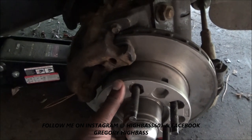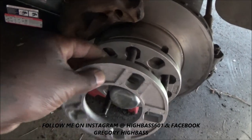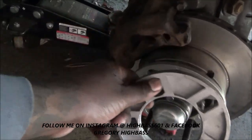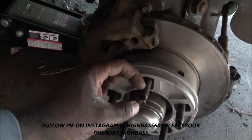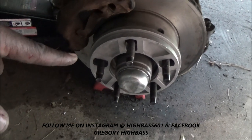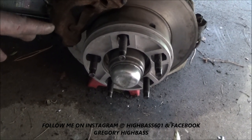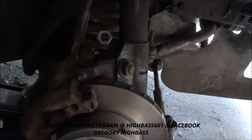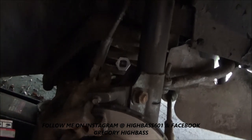If you want to know where I got these from, just come ask. This is how it's going to go — flat side this way. You see how much stud I'll have after the rim sits on there — that's the reason for extended studs to run these spacers. Most people don't run extended studs when they do spacers and the wheel ends up running off. But this car is pretty much going to be a trailer queen or just local driving.